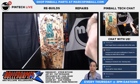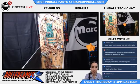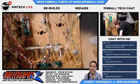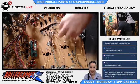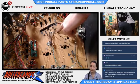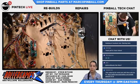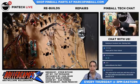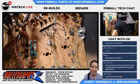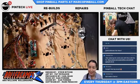So they snap in half from excessive ball impact - excessive pop bumper action. Now that we've got all this apart, we need to remove the last few bits of wire for the pop bumper lamp. These are very commonly stapled to the playfield since they carry lamp voltage - they need to be held in place so they can't short against anything. These are kind of a pain to take out. I have a special tool I will show everyone.